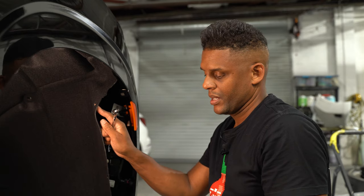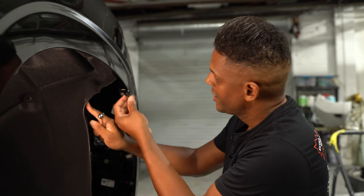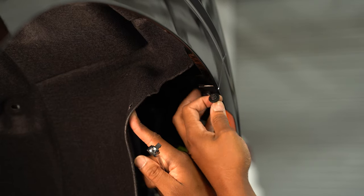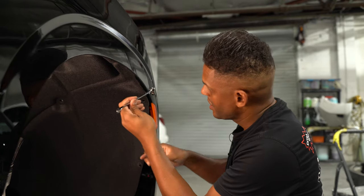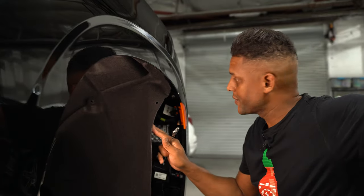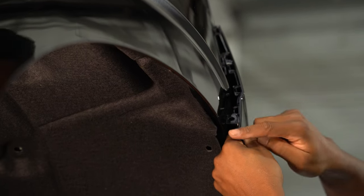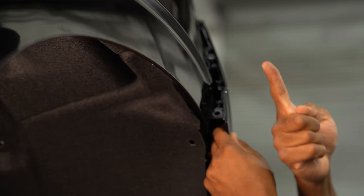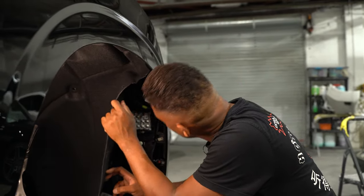That should loosen the rest of the fender liner. Up next, you're going to have a seven millimeter bolt again — same exact screw as in the corner of the fender liner — sitting here in the very corner, just one to pull out. Back it out, put it somewhere safe, then carefully but firmly pull out on the bumper cover like so. The whole side comes out — there's one bolt up top that needs to come out completely, and then repeat all the same steps on the other side.